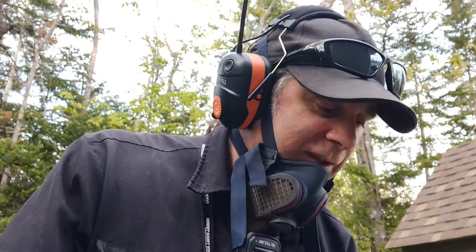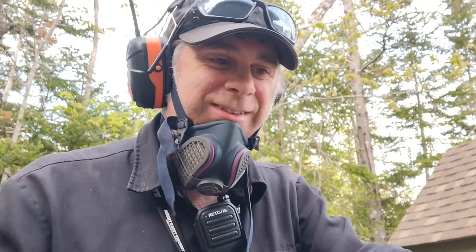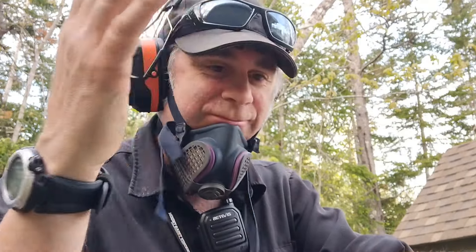That wire brushing makes a lot of dust that can really irritate your lungs and be bad for you. All this metal you're grinding off — you're inhaling it, and it gets in your lungs and rusts. Usually if I do it without my respirator I'm suffering for a while afterwards. So word to the wise: if you have the gear, use it. If not, do it in a very well-ventilated area. So let's have a look at what I use for holding my blades when I sharpen them.